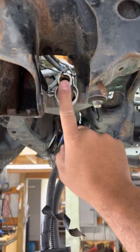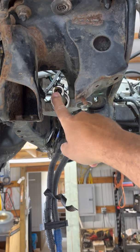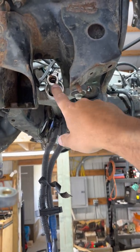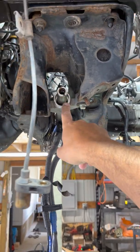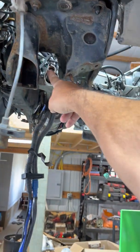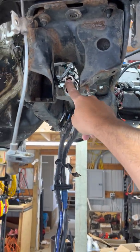Another cool development was a lot of guys are doing inserts on the inner tie rods. And when you do inserts to change the thread pitch from one to the other, the 22 STI, for example, supposedly has like an M20 or M22 thread in here, which is ridiculous to me. That seems really, really big. This one was M16, which is still bigger than the tie rods of the other years of the GD and everything. It's M16 on the inside end.